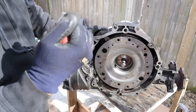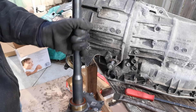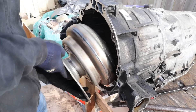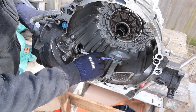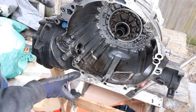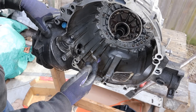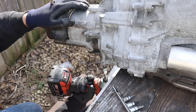Starting with the torque converter to see if we can pop that off. I need to remove the front drive shaft here — it attaches to the front differential and goes to the left side axle. Now I should be able to pop off the torque converter. We've got the front differential off to the right side with the axle going through in front of that torque converter. With a Subaru, for example, that differential sits just underneath the input shaft for a symmetrical all-wheel drive setup, allowing for equal axle length on both sides. I'm going to drain the transfer case oil.